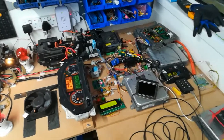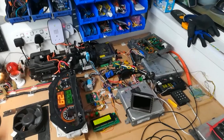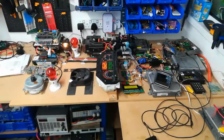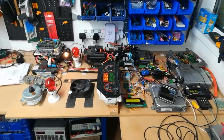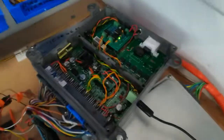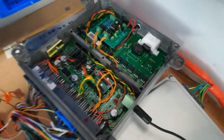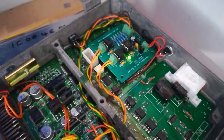This is a quick video to show the BCM interceptor with the 12F1840 PIC working in the bench setup. This is the bench car. The high voltage isn't turned on because it's not needed for this test, which makes it safer. We're looking at the MCM here — it has a BCM interceptor in it, and it's flashing away. That's the flash rate you would expect when it's working correctly.